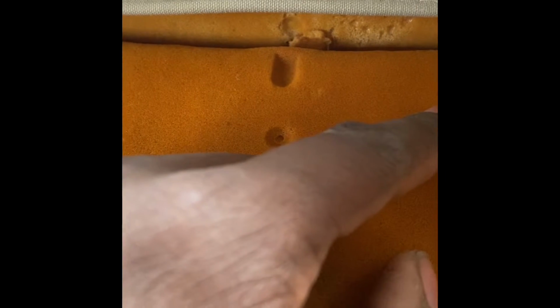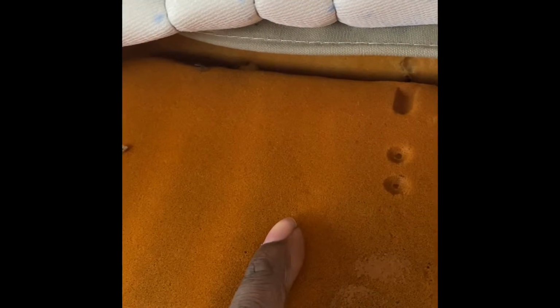So we got this first one. It's gotta be inseamed here. I'm gonna put about 5 or 6 hog rings in there, to that rod that's right there. It's a little rod in there. I'm gonna hog ring them down, and then I'm gonna start one on each side for the side seams, and I'm gonna work my way on down. But once I get finished doing this first one and one on the side, I'll be back.